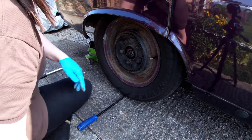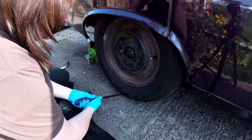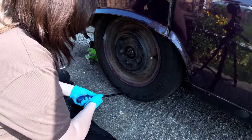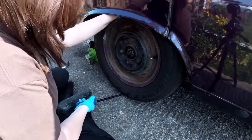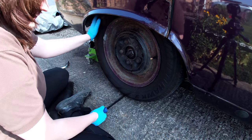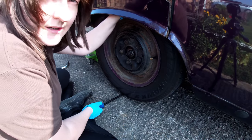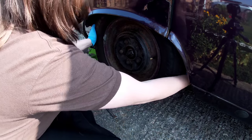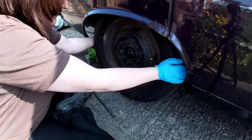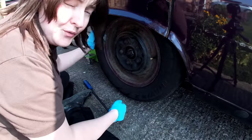Now my back end — Mr Jenkins' back end has been rebuilt a couple of years ago so it should all be good. We like to have a little wobble: get the bar underneath and see if there's any play in the wheel bearings. No knocking, no movement at all, which is what you want.